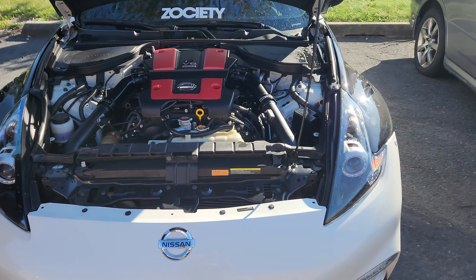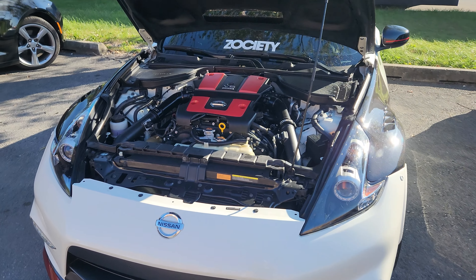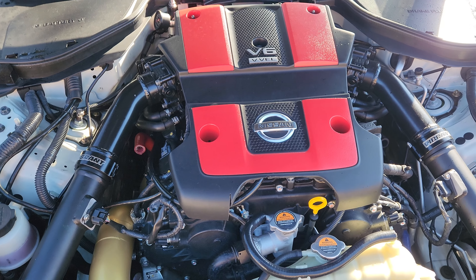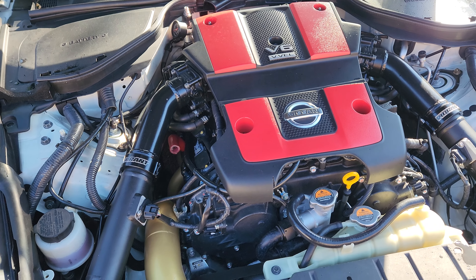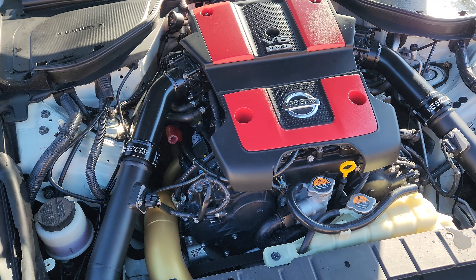This is a friend's Nismo — very nice car. I built the motor, he put the car together. It's a big single turbo setup, and there's a lot of money in this car, but he didn't put all the money into the fuel system. He's going to tell you how he pulls 800 horsepower out of this thing on a Mustang dyno at right under 20 pounds of boost.